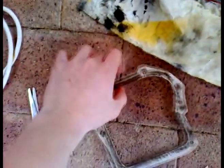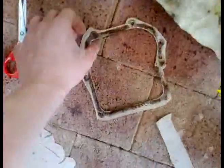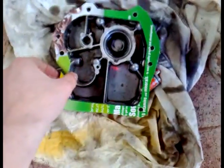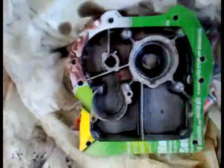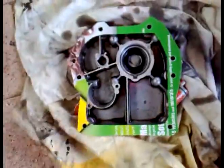Don't worry too much about the outside, because you don't want it to rip when you're putting it on. What you do is put the gasket in, bolt it all up, and then once it's in you can cut around the outside — that way it won't rip because it's got so much pressure on it and you can basically just cut around. I'm pretty happy with that gasket, it's pretty damn good.